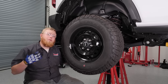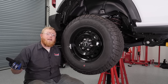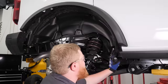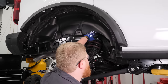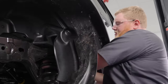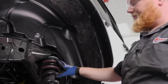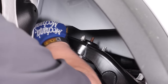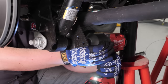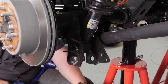We're ready to start our rear lift installation. We quickly realized it'd be much easier to do both sides at the same time versus going back and forth, so we're ripping the wheel off and lowering the whole axle down to get both struts out. We pull some of the inner fender well out to get easier access to the bolts on top of the strut. With the inner fender well loosened, we remove the upper strut bolts — leaving one on slightly to hold the strut in place — then remove the bottom bolt and take out the strut.